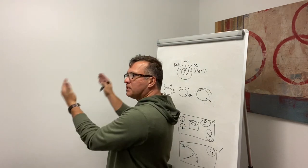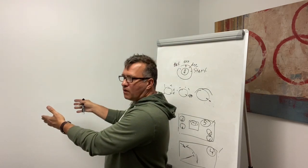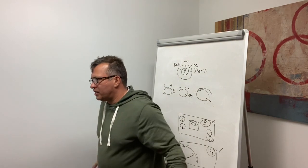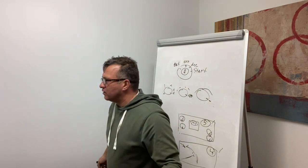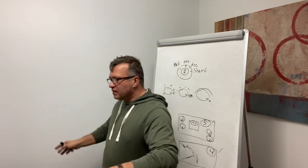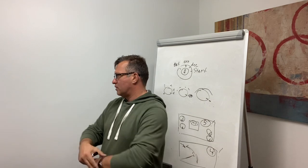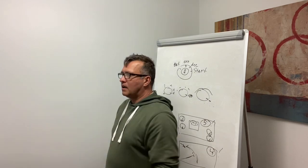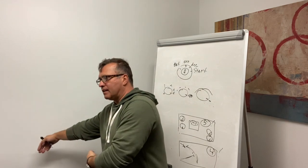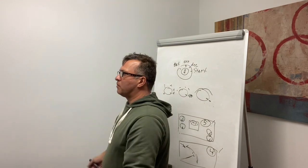Opening up the door, this is my fire extinguisher. Securely mounted, properly charged. You don't have to say what it means to be properly charged. You don't have to say that it's in the green zone. You don't have to check the date. It used to be a part of your test. Now, there is nothing in the handbook that says you have to do so. Climb inside of the truck and check the reflecting triangles and the fuse box on the top.